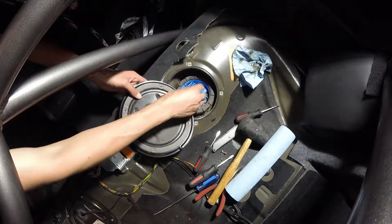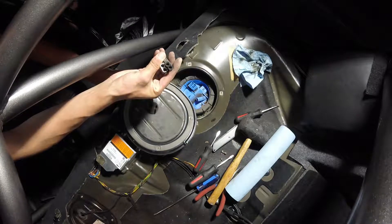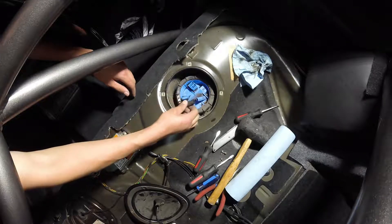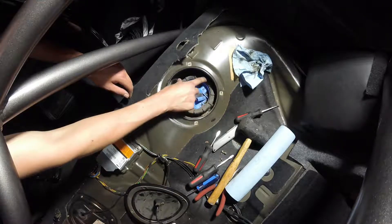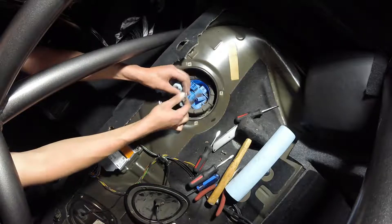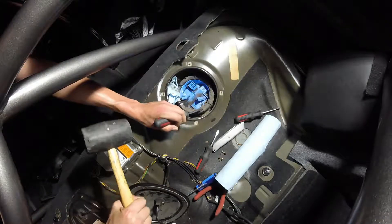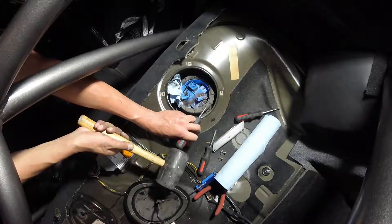These two connectors are connected to the fuel pump — that's how it gets its power. You don't have to worry about orientation because the plugs are different and can't fit into each other's holes. With the plugs removed and the fuel system depressurized, we can remove the hose clamp and remove this pipe — it will spill a little bit of fuel, that's okay, sop it up with a rag. The next step is to remove this outer ring — it's a locking collar. You remove it using a flathead screwdriver and some sort of persuading device. We're going to hit the tab counterclockwise.